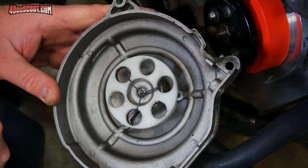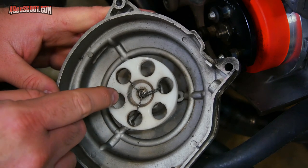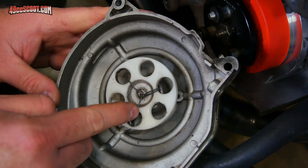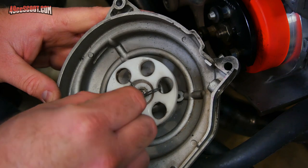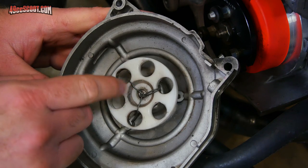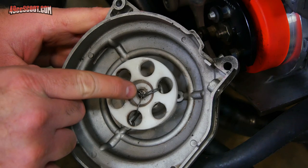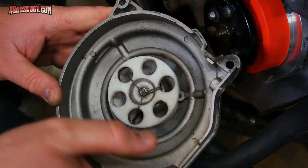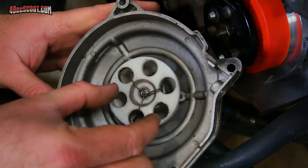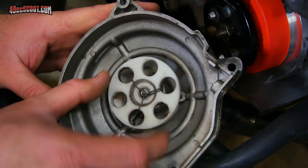I had mechanics wire in my toolkit, so this is what I did. I took the mechanics wire and I wrapped it around the impeller shaft underneath of the drive pin. And then I came up through all three of the unused holes in the drive wheel and twisted the ends together with a pair of pliers. It did break when I was trying to twist it together because this wire is apparently too brittle to put too much tension on there. But you can see it did hold together where it broke, and then I just kind of clamped it together, crimped it a bit. Just with the idea of that being to keep the drive wheel against the pin well enough that it couldn't just come off and lose its drive.